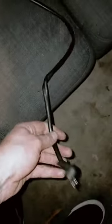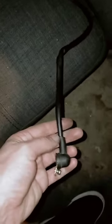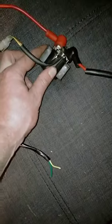The next part is your ignition. Power comes in through the negative because it's DC negative, which means your battery is at negative 12 volts. Power comes in through here and goes back to the battery. When you connect this part to power and this part to earth through a switch on your handlebars, that will then energize this coil, which works like a magnet, and it will clamp down and turn this into a closed circuit and make your starter motor work.